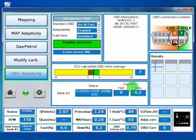And in standard fuel trims, positive values are leading to lean mixture, and negative values are meaning very rich mixture. So we can have even inverted fuel trims, where positive numbers of fuel trims mean rich mixture, and the negative numbers mean lean mixture.